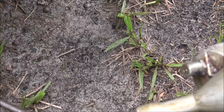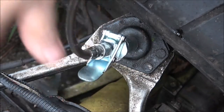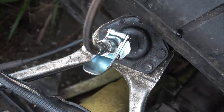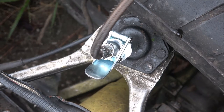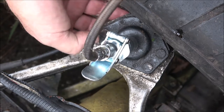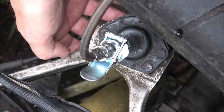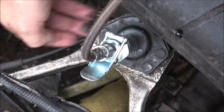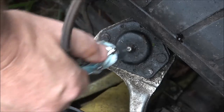Let's try the ball joint. Now sometimes these upper ball joints you have to jack up. Here's my other hand — I'm not holding it. And it's taking the grease just fine. I feel it — yep, there it is, it's coming out down here. There's the new grease coming out. Let's take this off.